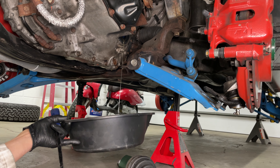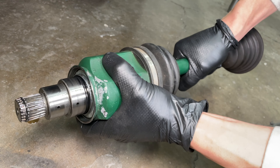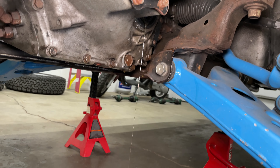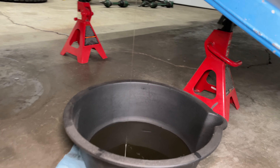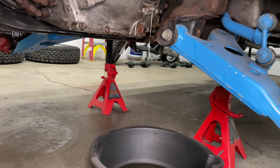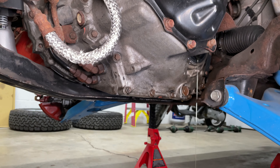Let's catch that gear oil. And this is the good one — it didn't leak at all, and there's not much play. There's a little, but it's a lot less than the other axles. There is gear oil spilling out of the transmission, but not very fast. If you wanted to be lazy, you could swap your CV axles quickly and not have to drain and refill the transmission, although you should check the level to make sure you have enough.